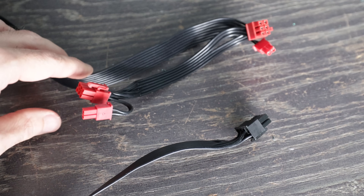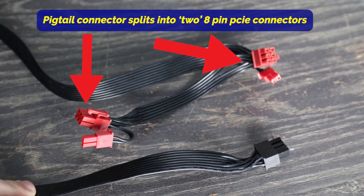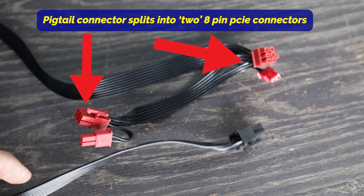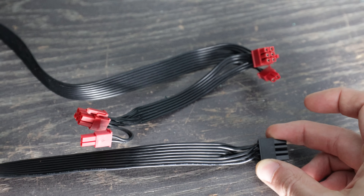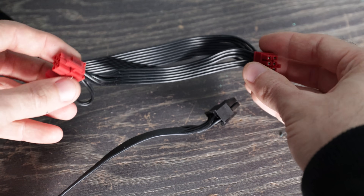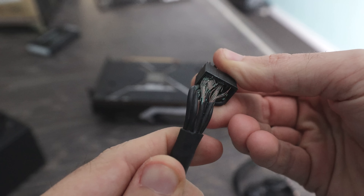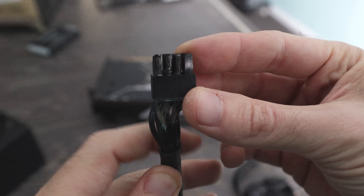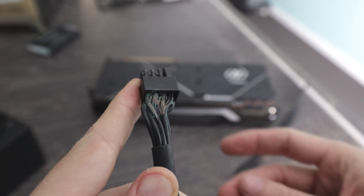What is a Piggy Tail cable exactly? A Piggy Tail cable is a single cable from your power supply that essentially splits into two 8- or 6+2-pin PCIe connectors, which connect to your graphics card. These are very common, especially on more budget-orientated power supplies that are not modular. Why are they included on nearly every power supply if Seasonic is starting to recommend against them? Well, meet Exhibit A. This is a power supply I picked up off a miner over a month ago, and one of the connectors was fused at the modular connection point going from the cable to the power supply — and this was, as you guessed it, on a Piggy Tail cable.